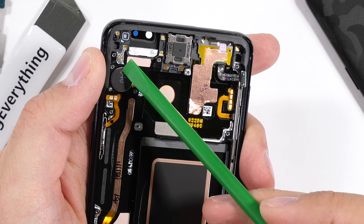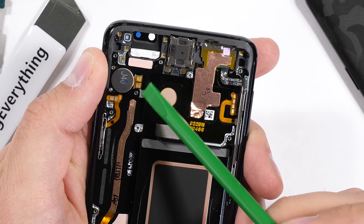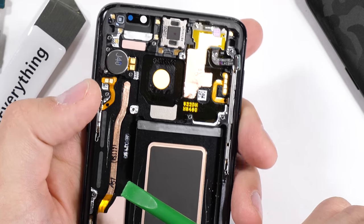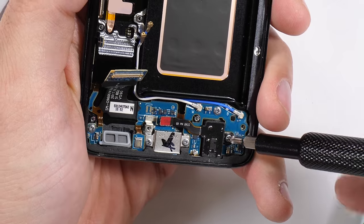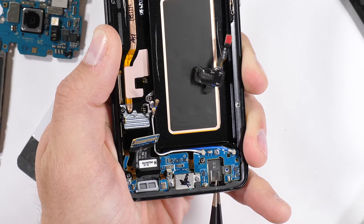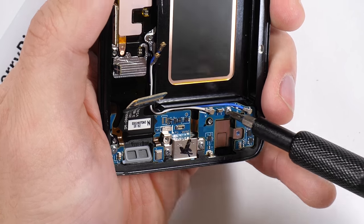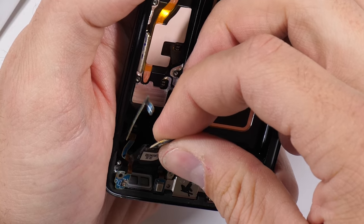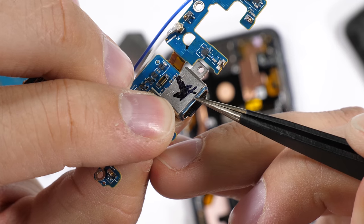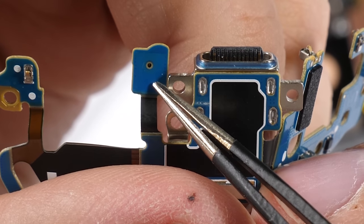It's got a little circular coin vibration motor inside with its little gold contact pads. I still need to make that vibrator explanation video since there are several types used in cell phones these days. Our little buddy Jack is tied in with one screw and a Lego-style connector here at the bottom of the phone. There are 4 more screws holding down the charging port into the phone frame, and the whole thing pulls up and away pretty smoothly. It's got a little rubber ring around the USB-C port to help keep water out, and microphone holes down here on this board as well.